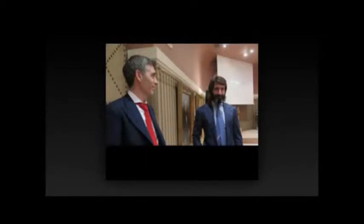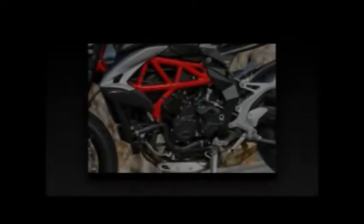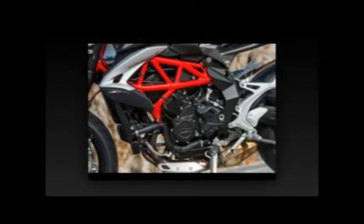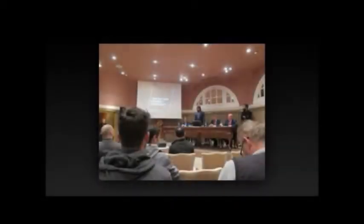The new bike still doesn't have a damper, but it does have 1 degree more rake, 24.5 degrees now, along with 8.5mm more trail, 103.5mm now, and 20mm more wheelbase, 1400mm/55.1 inches, in a slightly stiffer hybrid frame of MV's signature steel trellis and aluminum side plates. Those changes turn it into a paragon of stability over the mostly smooth A397 that climbs to Ronda from Marbella on the Costa del Sol.